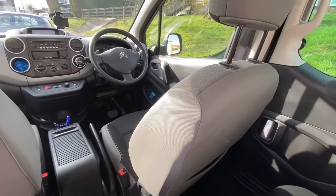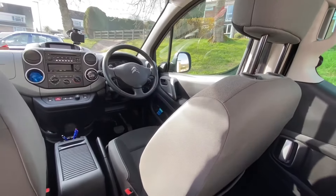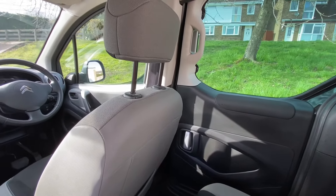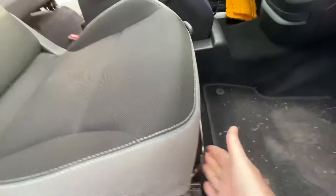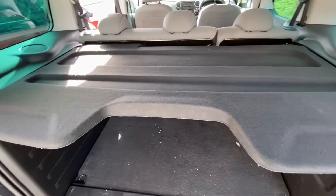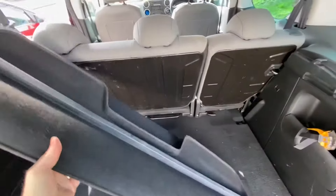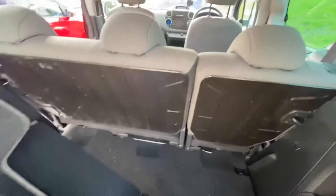Without any further ado, let's get on and see if we can get these rear seats out. A couple of things to do before getting the rear seats out: we'll move the front seats forward a bit, because before you get the rear seats out you actually have to flip them forward, and it'll give you a bit more room. Pull the front seats up and out the way using the bar there. The second thing we'll do is get rid of the parcel shelf — it just pushes up, lifts, pull it back, and then it lifts out. That's just a bit of prep to get us ready.